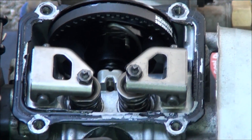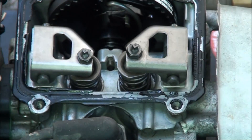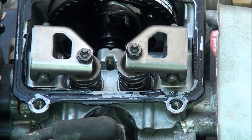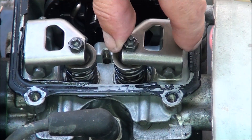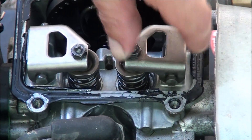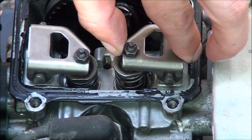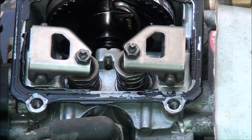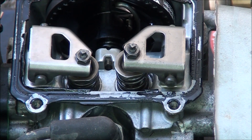So what is going on with these valves? That could be a noisy valve — can you hear that noise? I'm going to slowly pull the pull rope and work it through to see what's going on here. It doesn't seem like much play there, but that's probably the problem. That is the exhaust valve — it doesn't move much, but I think it's probably out of adjustment. Let's get my feeler gauge and check it out.